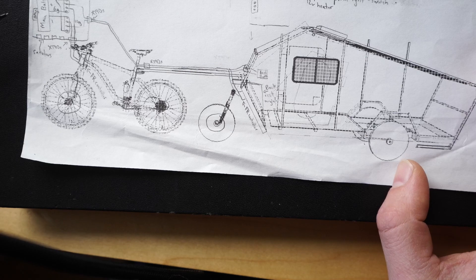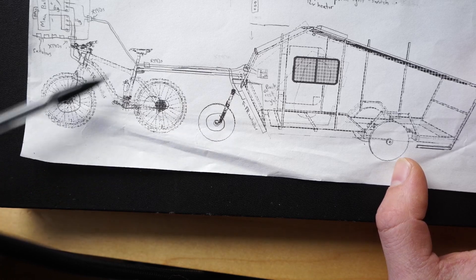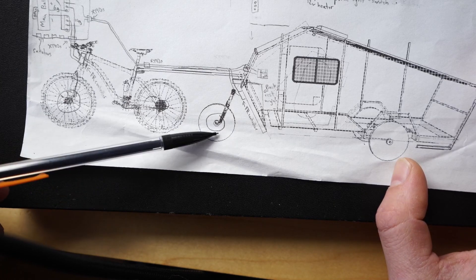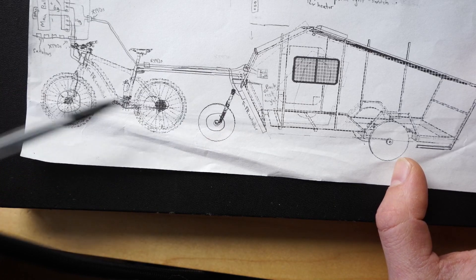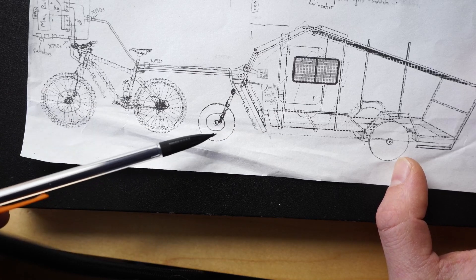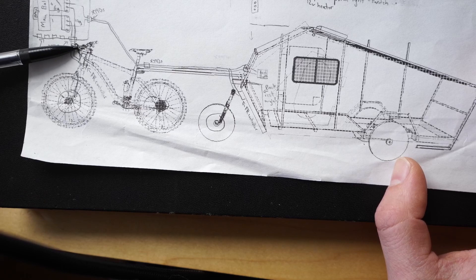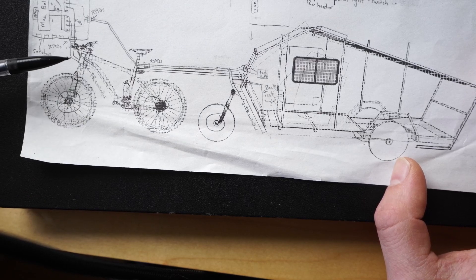The first solution was definitely very workable. You just have to make sure the weight balance between you on your bike, the front hub motor, and the trailer weight is fairly equal — otherwise you get issues with torque sensing and a stuttering front wheel. So those are some issues to look out for with the first method, which is the simplest. I'm going to test the second method and I'll do a future video on that.